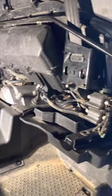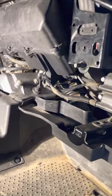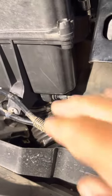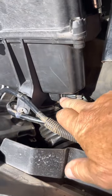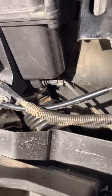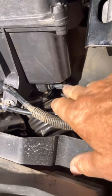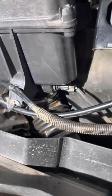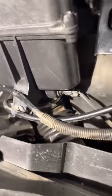Did a little research and I discovered that here on the air filter box, on the bottom of that box, there's a plug right here — it works the intake air temperature sensor. I had unplugged that when I took the box off and it fell down, and I didn't see it when I put it back on.